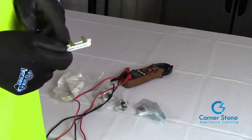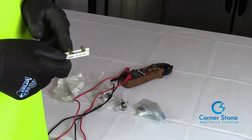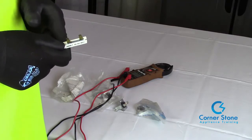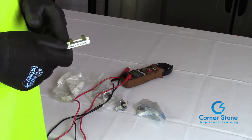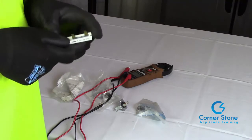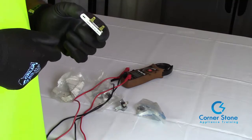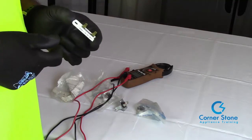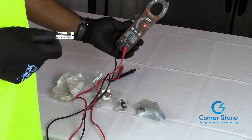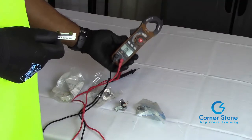Last tip: if the vent going outside the home is going through the roof, I show you a simple way to test it in the membership area for those of you interested in starting your own business. So again guys, check your thermal fuse for continuity — it's simple. All you need is a multimeter. Always unplug the machine or appliance before you start testing any parts.